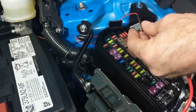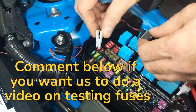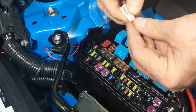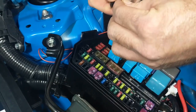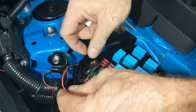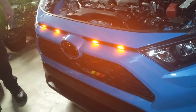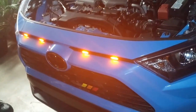So we ran into our first snag — went to try to plug it in and it did not work. We tested the fuse on that and it does not get power; it's just a dummy. So we'll try this one. We should have shown that problem. I think we've got some footage of the pitfalls part of the install. Okay, let's see if that fixed it. That looks pretty cool! So it worked — I just had to find the right fuse.